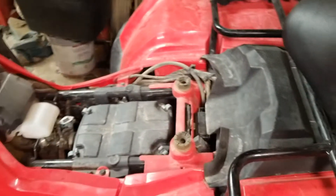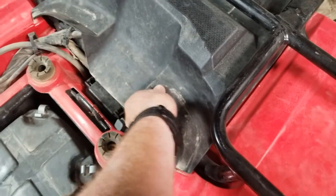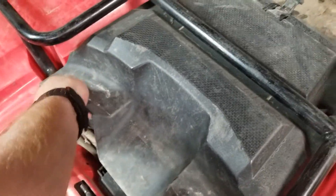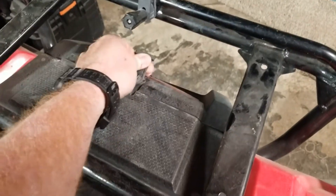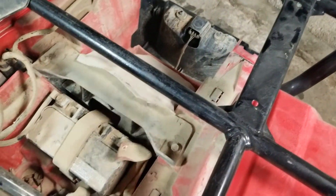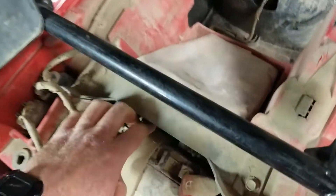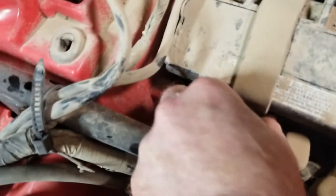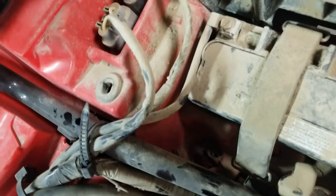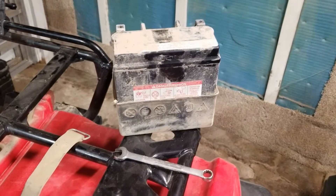To do so, starters just remove the seat. For those of you who don't know how to change your battery out, there's a little latch in the back — you grab it and pull up really hard. Next thing you're gonna do is unhook these two terminals, take those off, and then you've got your little clip that holds the battery in. We're gonna pull that out.